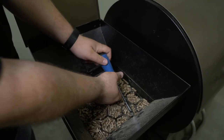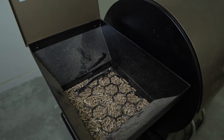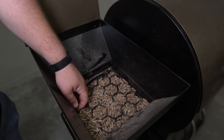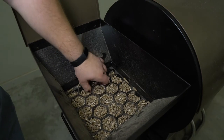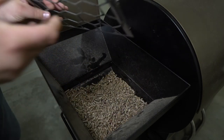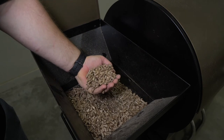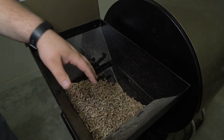They put the cage in for safety reasons — you wouldn't want somebody sticking their finger down into a moving auger. Before you get any further, make sure that you have this completely turned off, and probably even unplugged like mine is right now. But now that you've done that, you can just lift the cage out. With the cage out of the way, you can use a cup or a small bucket to scoop most of these pellets out.